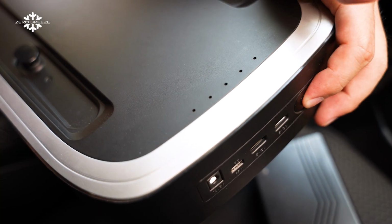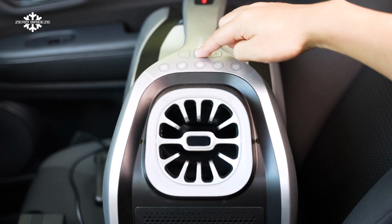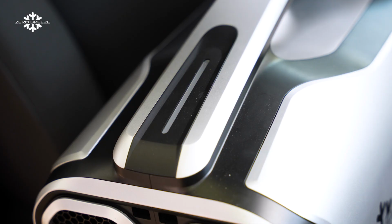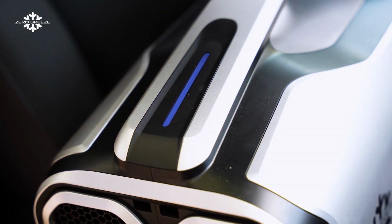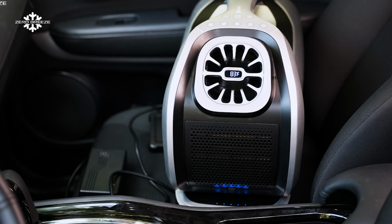This setup delivers a maximum charging power of 120 watts to the battery, keeping it fully charged and for the continuous operation of the Mark II AC. However, if the AC's power consumption exceeds 120 watts, the battery can only sustain the AC at maximum power for up to 7 hours, even while charging.